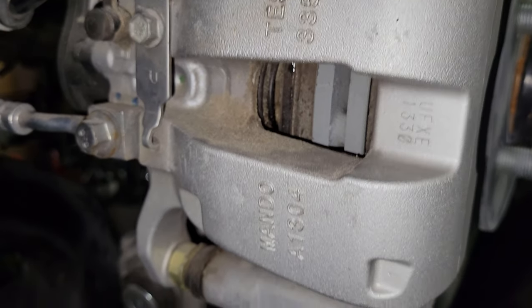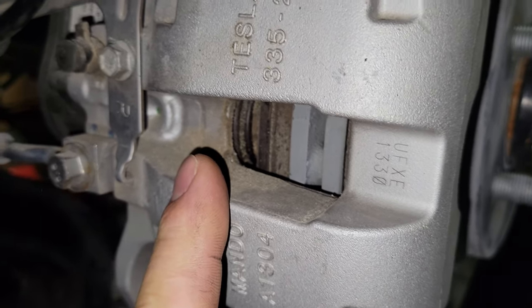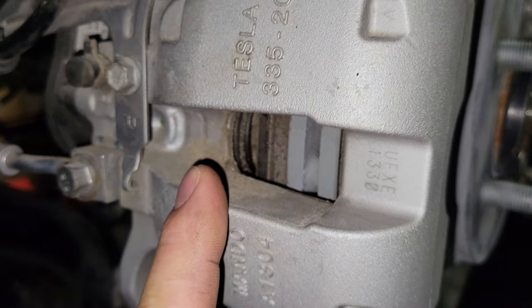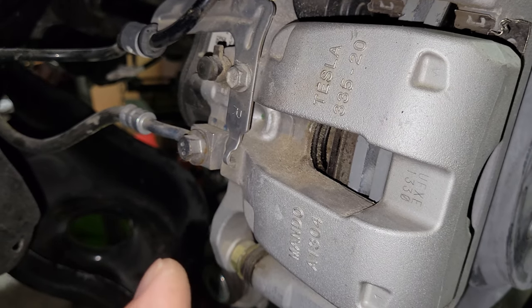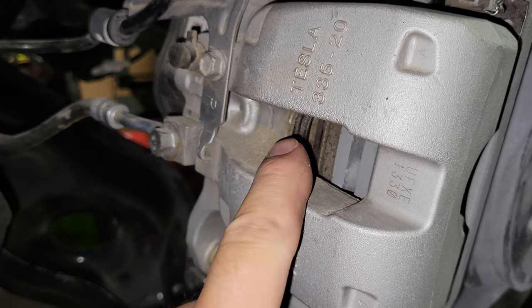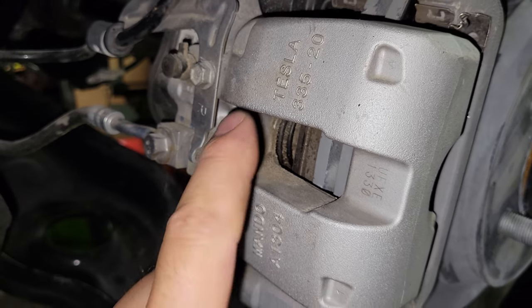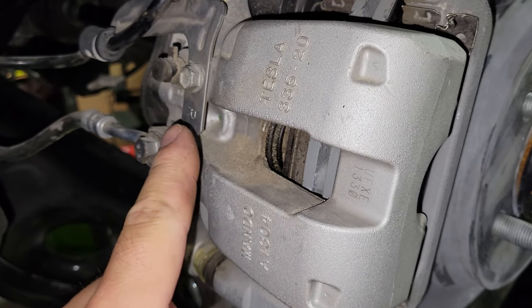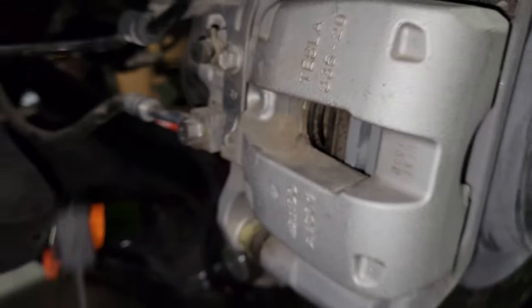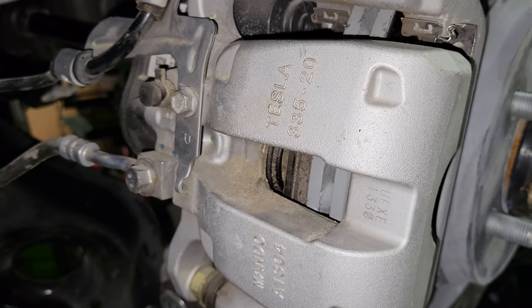This should separate the caliper and remove it with the pads left inside the lower half. Now it's time to push the piston in as you would any other brake on any other car. However, this is where Tesla differs from all other cars — there's a mix of not just pushing but spinning. We're not spinning the actual rotor itself; we're going to spin the motor on the backside. But this piston will get pushed straight back by a typical clamping tool. However, you can't just do that while the electronic parking brake is still attached.